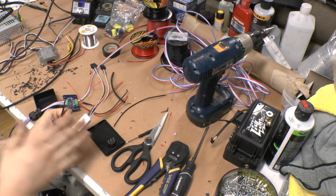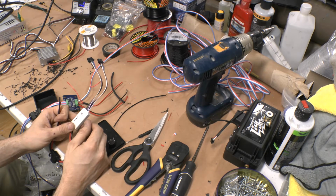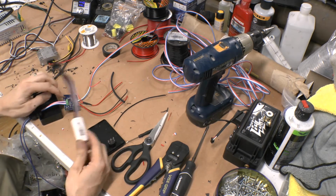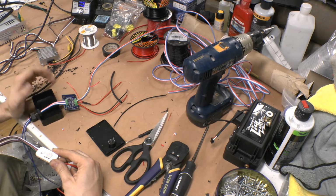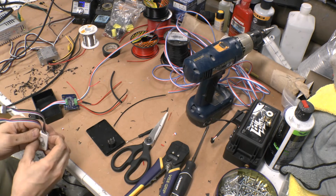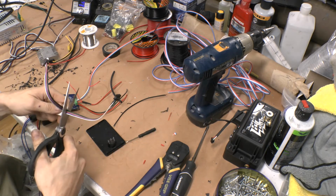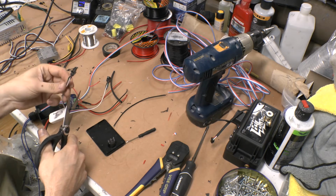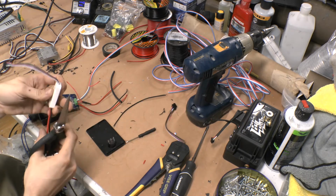And more often than not, I ended up designing this, coming up with this combination for the box. I used to be able to put this whole thing in there as is, but they added these screw terminals, which is awesome. I love the screw terminals, very happy with them, but unfortunately it won't fit in there now. So what I do is I have to actually open this up, pull that out. I'll actually cut off one of the leads here because it's kind of hard to get 2 leads to run out, and being that it's RGB, all I have to do is split off of this once I run one side out. So I just cut one side off.